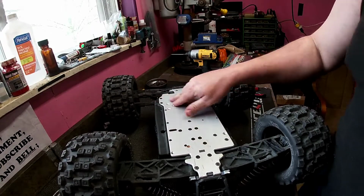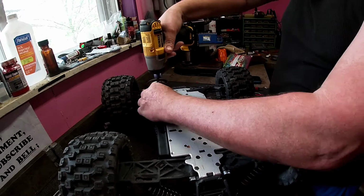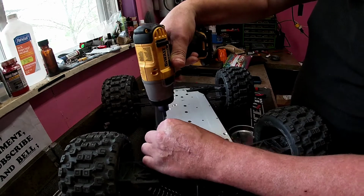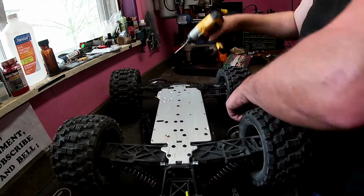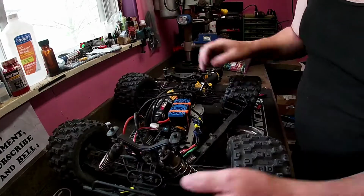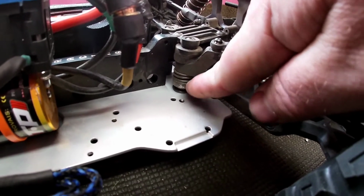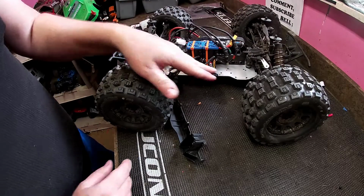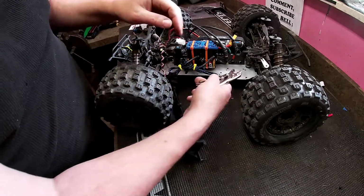To get that done, I think I need to go ahead and unbolt this whole side bracket piece here. All right, and as you can see, that piece has already fallen off. And that lets me get right in there to that servo saver with a pair of pliers. Yeah, I think that's still set too tight. I had it set to factory specifications, what it said to in the owner's manual. But that seems even still too tight.